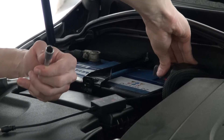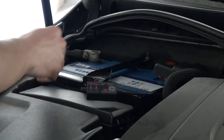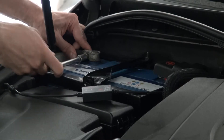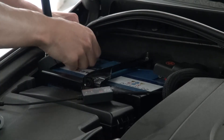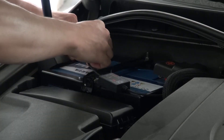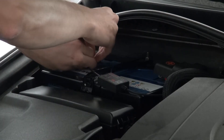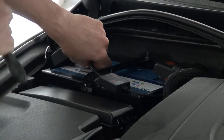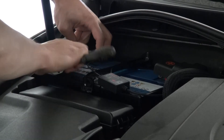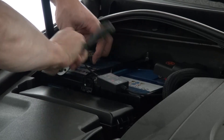In this video I want to install, for the future, a battery monitor. It's a Bluetooth battery monitor and it's very, very easy to install. As I just showed you, and I'll leave a link in the description below, you can purchase it on AliExpress or maybe also on eBay. It's around $20 to $25. What it does is it monitors your battery life, also your cranking voltage, and the voltage when the car is running. And if something happens, you will get an immediate notice on your phone.